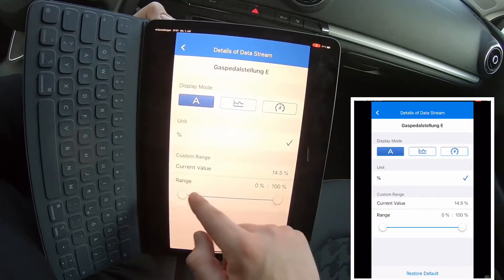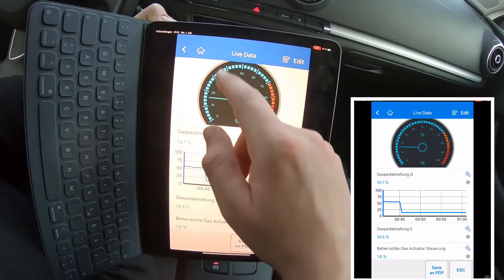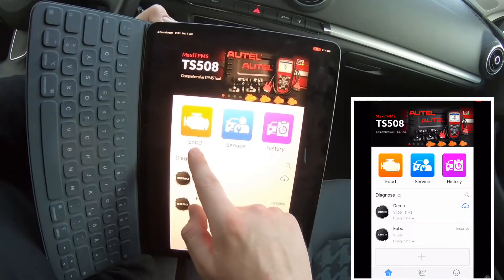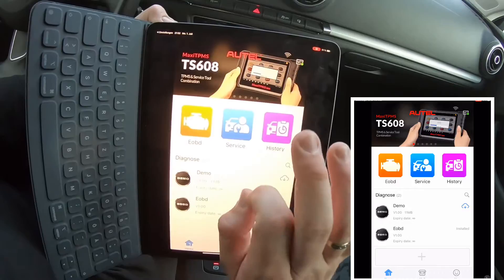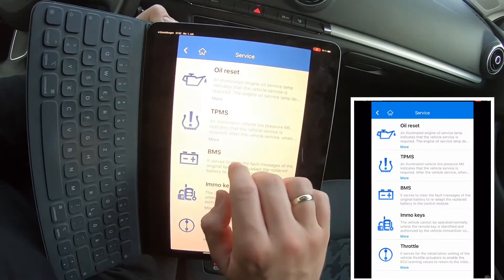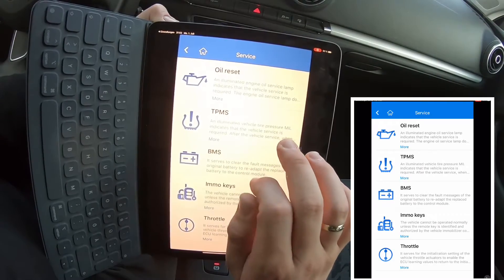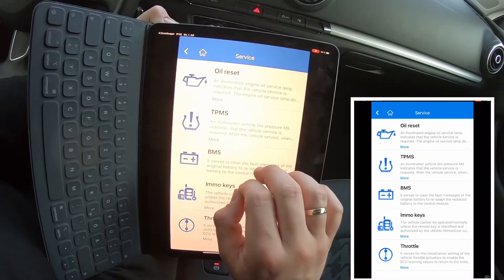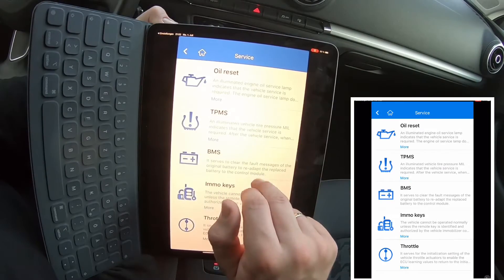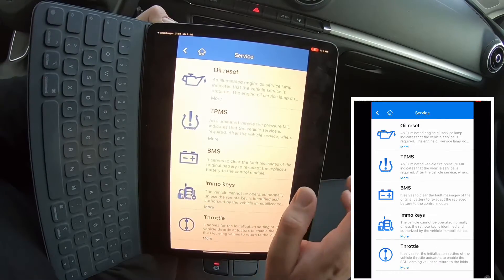After fixing, you can delete the DTCs and job's done. There are also OBD2 signal protocols such as SAE J1850 VPW, PWM, and ISO 9141. These are all protocols which can connect to your vehicle. The most common protocol now is CAN — the CAN protocol was developed by Bosch. These different types of signal protocols are all embedded in this software, so you can plug into nearly every vehicle with all the available slots or ports.